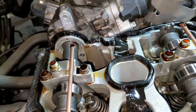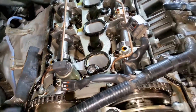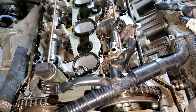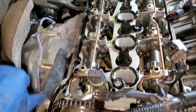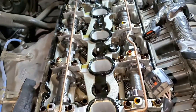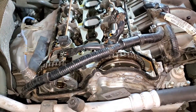Once we get this gasket removed, I am going to be extremely careful when we clean this because we do not want any dust going into the engine. Before I remove this gasket, I am going to go around with a cloth and brake cleaner fluid to clean the exterior perimeter dirt off. Once I am done that, that is when I will actually try to remove the rubber gasket material. Then I will show you how I am going to protect the top and clean the other areas outside of the valve body.